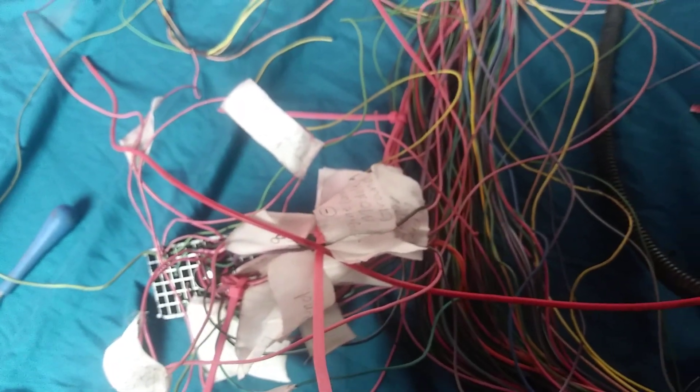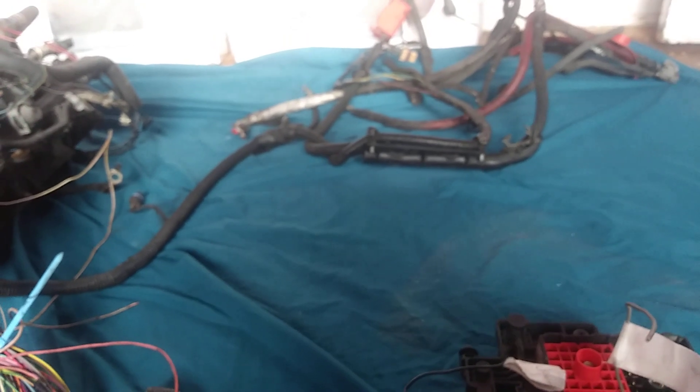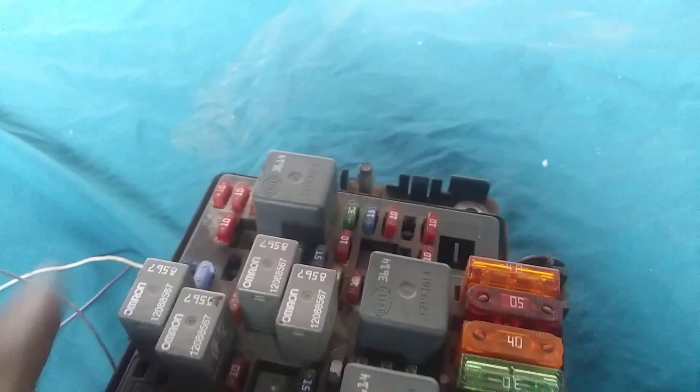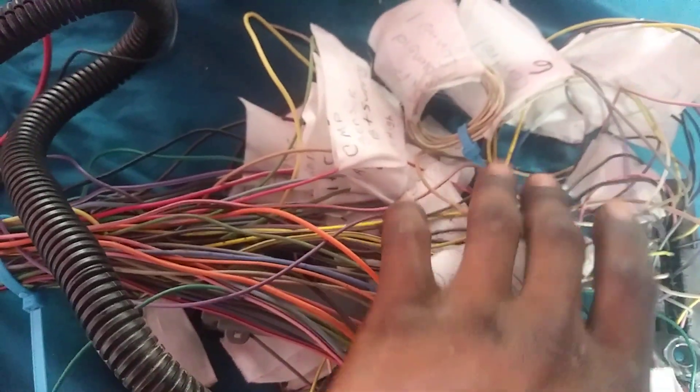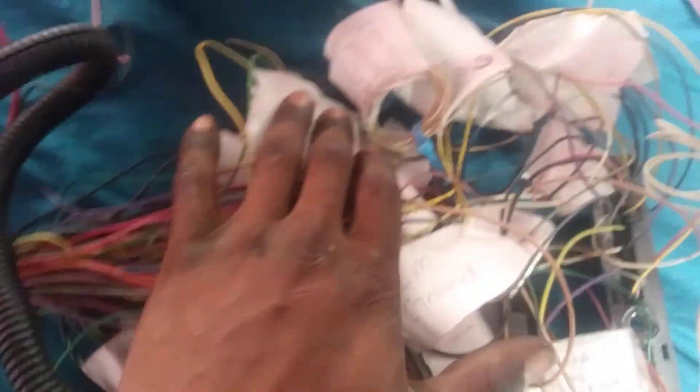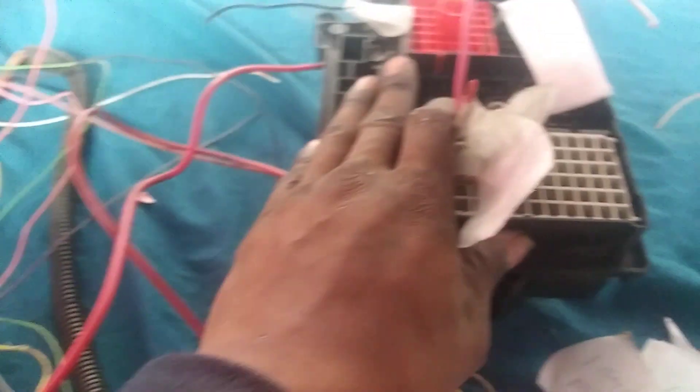Pretty much you don't want to be cutting wires that you do need - if you need them you better go ahead and reinstall those wires. Over there is the battery stuff; I left it hooked up so it's easier to put on my motor. I'm going to be removing these wires off the fuse box, and right there is going to be the battery to power the fuse box. The body control module and security have been removed from the PCM, so it should turn and go after I've finished my deleting.